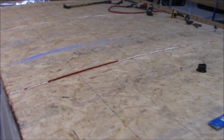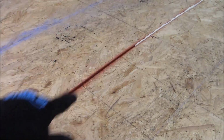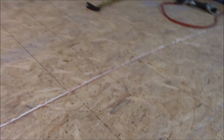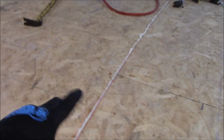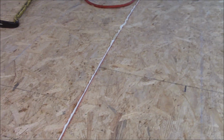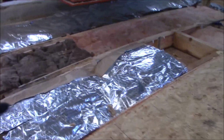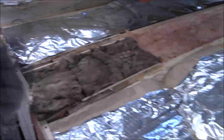We had to add some insulation in certain areas, I think back here, a couple other areas. So we got a skylight right here, that's why that looks a little raised up, so we got to cut that out anyways. I got another burp over here where there's a double truss. That double truss, one doesn't want to sit the same as the other, so we'll sand that down, this little burp. Not very much, but still I want to sand it, and then we'll put that protective strip over it. And then I got one more piece right here, which is like 49.5, so I'll have to cut these other 2 sheets.